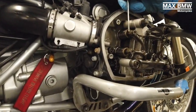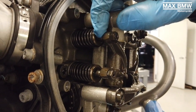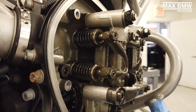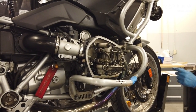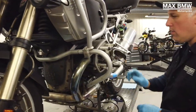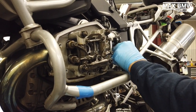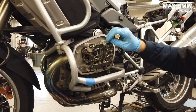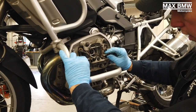Over here I'm going to show you that portion of the rocker arm — I can't move it because it's on valve overlap, and you can see how the springs have some compression on there. Now before you start changing valve clearances or even checking them, you should always check your rocker arm end play first. The rocker arm end play spec is 0.05 millimeter to 0.40 millimeter.